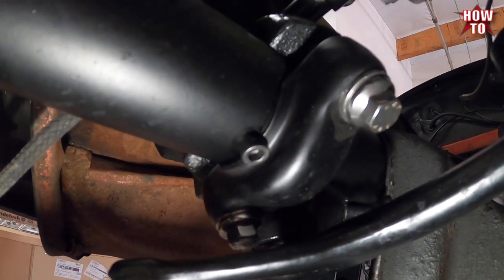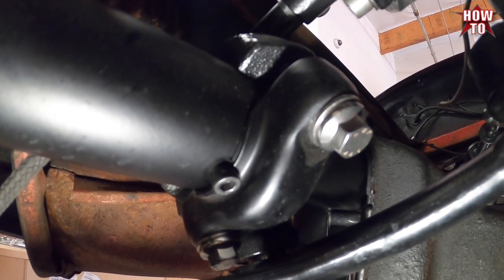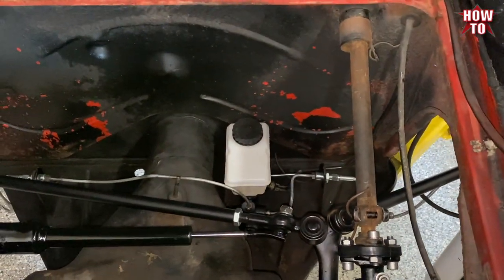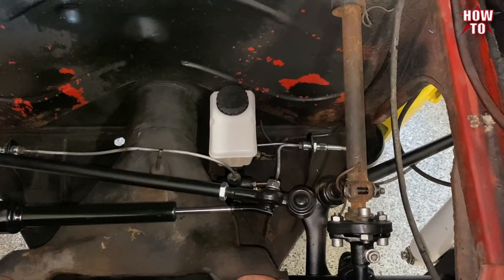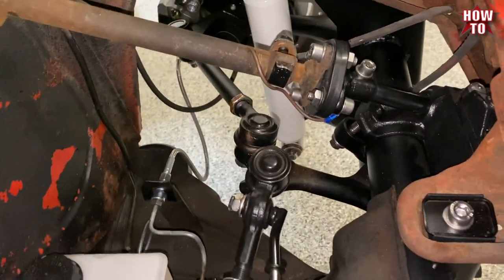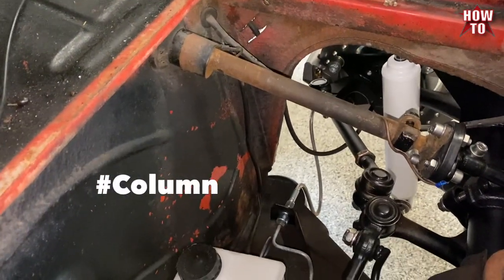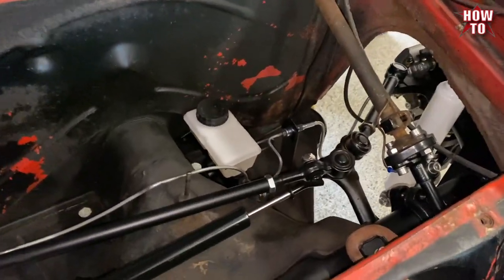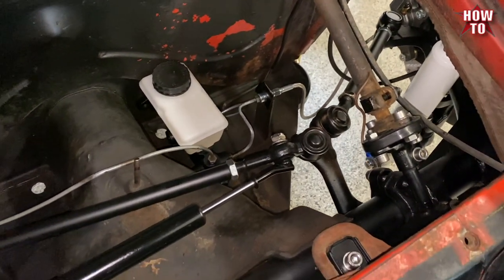These pins are exactly where factory is. So with knowing the history of this car, things are probably moved, but we can accommodate it. This car keeps showing us its skeletons. The steering column is bent. So as we rotate it, it kind of wobbles. So we got it in alignment pretty easily. And it misses a steering box, but obviously if this is my car, I would replace it. But it's not, so it's just one of those items that we recommend to the client. Hey, you should probably look at this as funds allow.